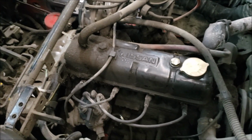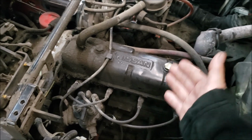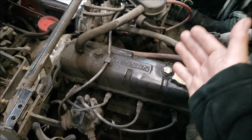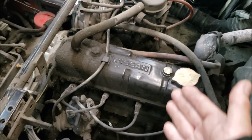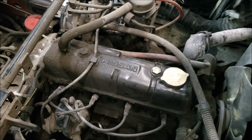So here's the thing. Battery voltage at the battery drops down to 4 volts, right? Does it matter to measure the battery voltage at the battery or at the starter terminal? It does not anymore, because even at the battery, it was already at 4 volts. Okay, so that's the battery.